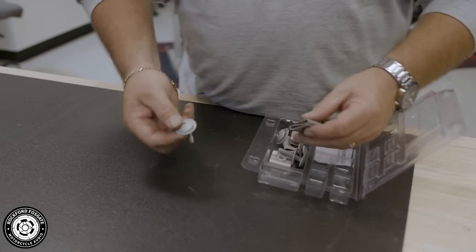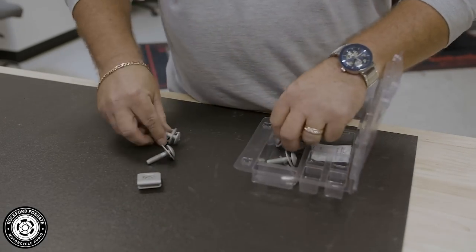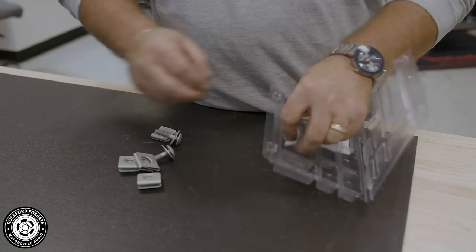Now you can install your brake side saddlebag using the provided hex screws and the Z-clips labeled bag mounting screws in the blister pack. The Z-clips will replace your existing pin locks. If you have stock screw-in bag mounts already, you do not need to replace the Z-clips.